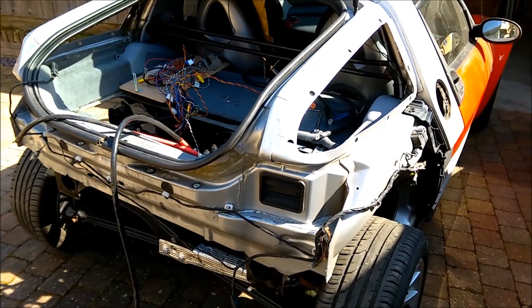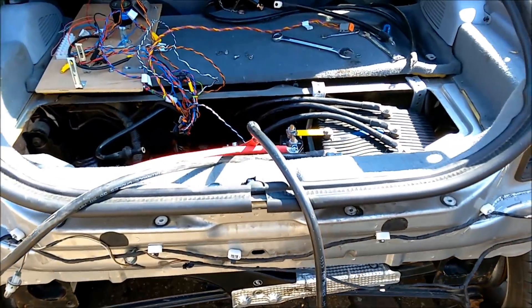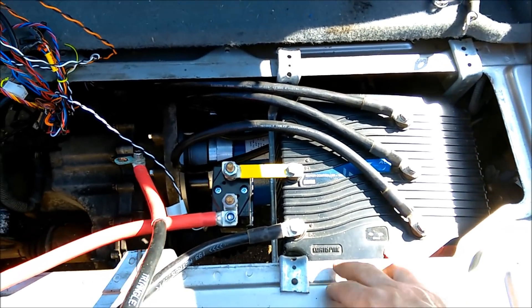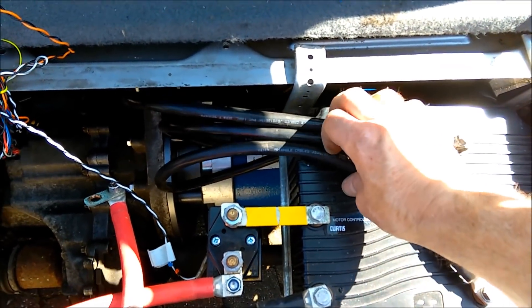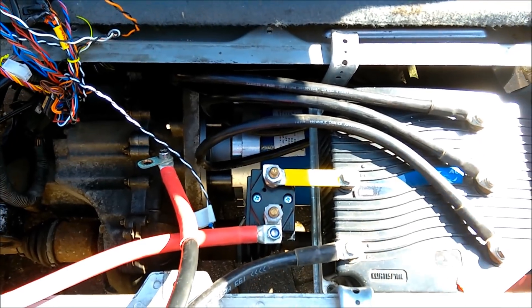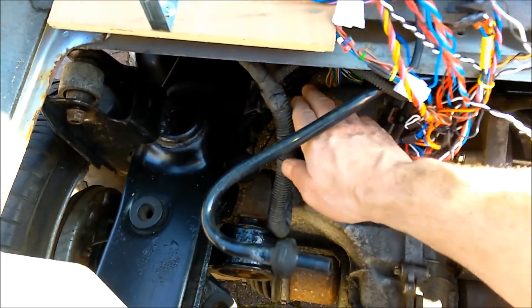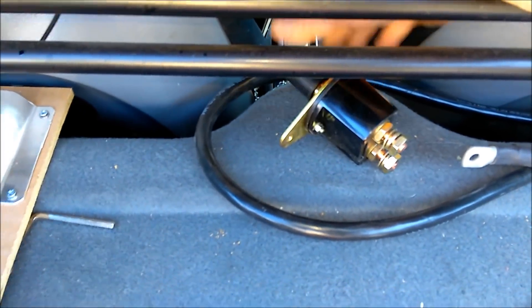It's the hottest day of the year so far in the UK, so perfect day to get something done on this. I've just put the chassis back in and I thought I'd start laying out some of the main parts to decide where they're going to go so I can build the box. I've made some very temporary brackets just to hang things in place to get some idea of space. I think if the controller goes on that side it gives me a nice short lead to the motor. I might direct-couple the solenoid to the controller, and I'll need the big start switch. The batteries will go in all this space around here and I can build them right forward under that bulkhead. I might put the big power switch just here - it's a perfect shape and will give me access from inside as well, in case anything goes wrong.